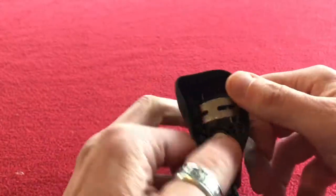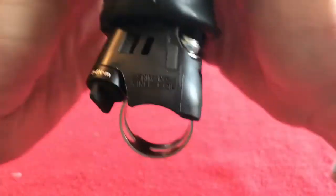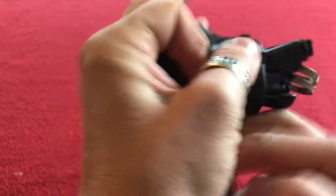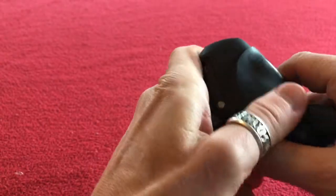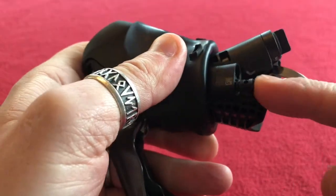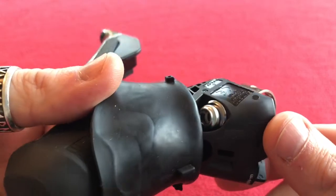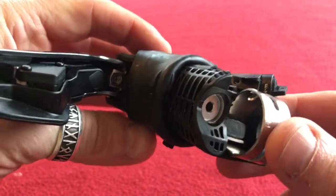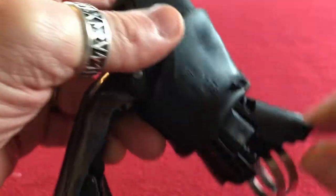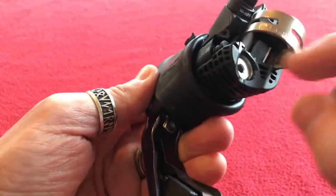Let's peel back this and have a look at it. So we have Shimano mineral oil, five to six newton meters tightening. We also have the double Di2 port, which you can push out a little bit — it's got one that's blanked off. Everything looks to be as it should be in there. I can undo it — no problem. I can undo that and do it back up. Everything seems to be in order.